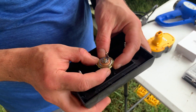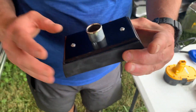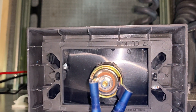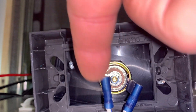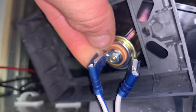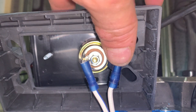We just disconnected this from the back of the slide, and here it is — this is all that's on the back side of your slide right where your refrigerator's 12-volt plugs in. So we have our 12-volt outlet taken apart here. It's just two screws. You can see the back side — we've got two wires. The center terminal is positive, and the side terminal is negative. The wire with a blue stripe down the center is positive, and the white wire is negative. We're just going to note that so we remember which one is positive and which one is negative.